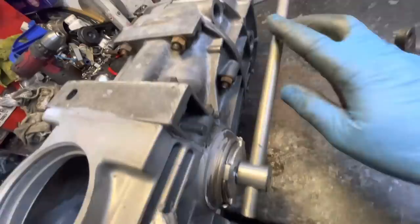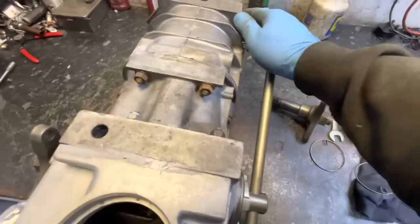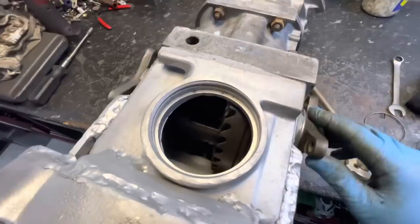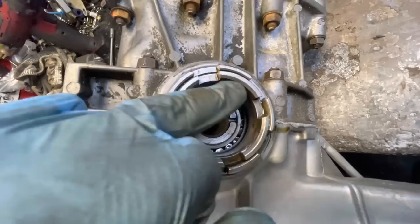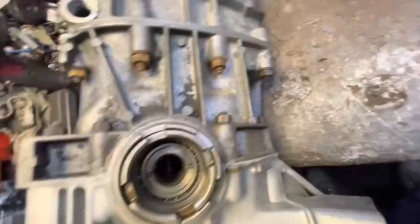These are the output flanges and this is a special tool we use to put inside the cups with the fine thread. By turning one clockwise and backing the other off we put a preload on the taper bearings which holds the diff in place. I won't go into it because it is a specialist thing that really deserves its own video. Last thing to do is put the snap rings on - they basically locate the two parts so the outer part sets with the goo and the inner part turns, and when the snap ring goes in it stops it from undoing itself. So there we are - the Rover V8 gearbox is finished, all ready to go onto the engine, which will be the next video. Hope you've enjoyed it and you don't think I'm too mad.